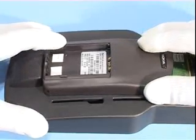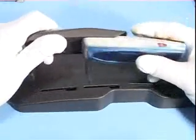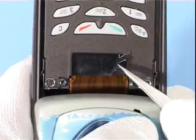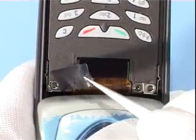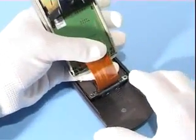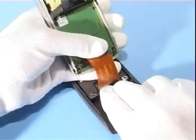Now the grip has to be unlocked. Be careful with the flex foil, which connects the two modules. Remove the protection tape carefully. If you keep one finger between the covers, you will protect it from scratches. You can use SRT6 opening tool to open the flex connector smoothly.